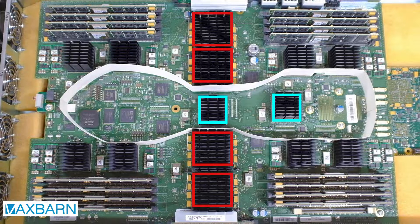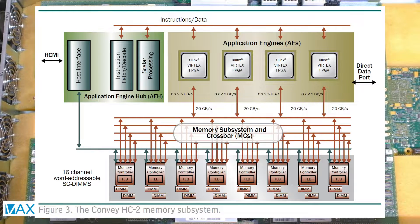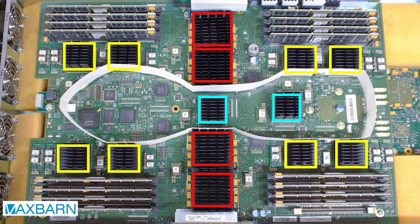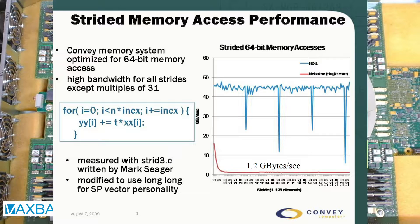All these FPGAs which implement the processor are connected to eight memory controllers, which provide a crossbar to a 31-way interleaved 16-channel DDR2 memory subsystem. The 16 4GB DDR2 DIMMs are non-standard. Standard DIMMs could be used, but this system is outfitted with scatter-gather DIMMs. An FPGA on each of the DIMMs provides scatter-gather functionality, which basically means that the DIMMs are optimized for addressing individual 64-bit words rather than entire cache lines at a time. This makes the memory subsystem much faster for problems that address memory in a random or strided fashion. The bandwidth of a regular memory subsystem with caches collapses rapidly if not every word in a cache line is used, as this graphic from a Convey presentation shows.